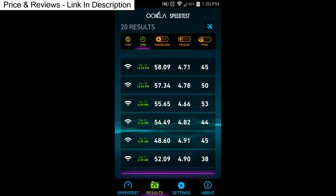Next we have the test results for the AC1900 on the 2.4 gigahertz band, and what an improvement. The powered antennas grant amazing range on the 2.4 gigahertz band, which provided me with a solid connection throughout my entire house and even the basement. With download speeds in the 50 megabits per second range, it had more than doubled what I was able to get with the WNDR 3300. Upload speeds were rock solid as well, giving me the max my ISP is providing, and the ping is in a comfortable 45 millisecond range.